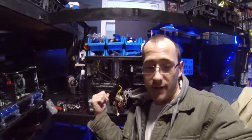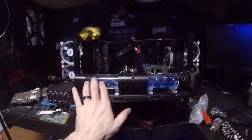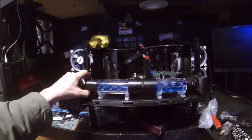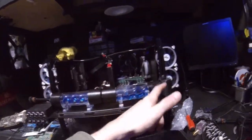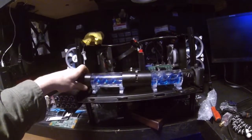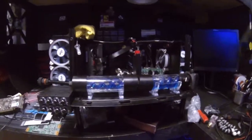A friend of mine gave me this computer and we're going to work on it and see what's wrong with it. Good news: the second reservoir came in for it. I need to take some washers and raise it up just a little to promote the water to flow toward the pump, because if I leave it level the water is just gonna sit there. I need to get it up in elevation so the water will naturally flow toward the pump.